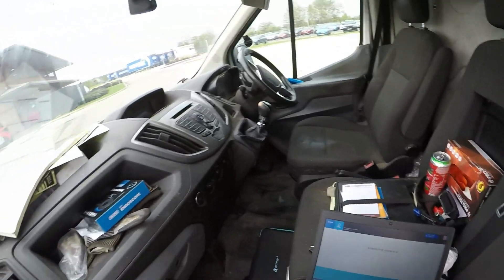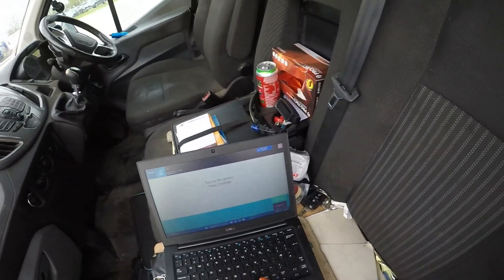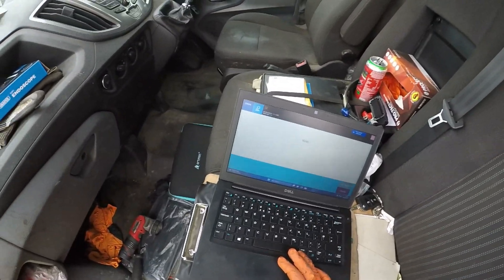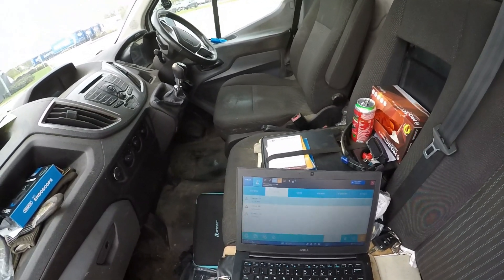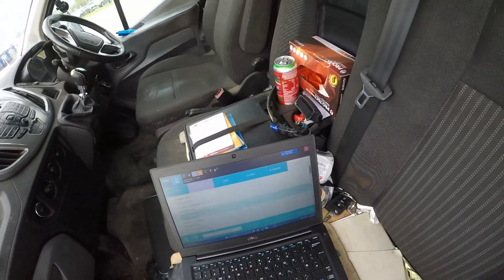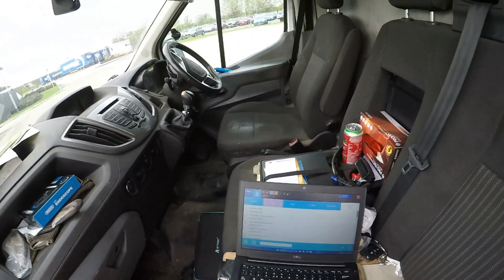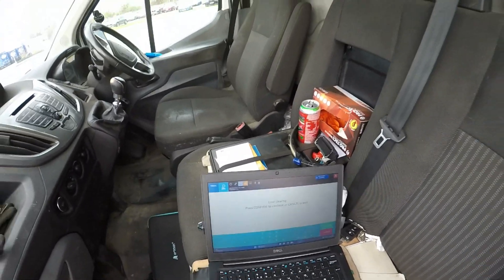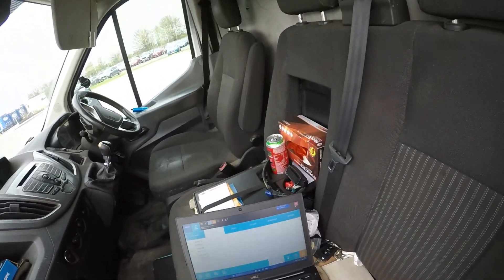You should see the faults are all to do with either the control unit or the wheel speed sensors, because obviously it hasn't been programmed yet, so it'll be having a hissy fit at first. Sensor 2A, sensor 2B, and control unit — so those are your ABS and wheel speed sensors. ECU operation complete — we've just reprogrammed the ECU. As you can see, they've all gone green now, which means they are clear. So we just cleared those faults — this can all be shut down now.